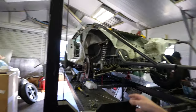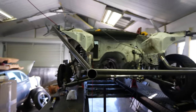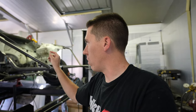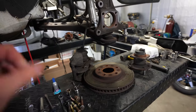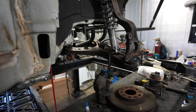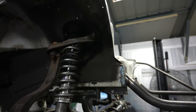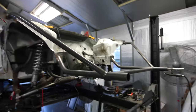We've got to put the wheel tubs on the front eventually and freshen up the front end stuff, but it's coming along. Really pretty easy to install — just making sure your cuts are as square as possible is definitely going to help. I have a few little gaps I'm having to weld but it is what it is. Alex has been working on getting all the old brake stuff out so we can get ready for the new brakes — came out pretty decent for a car with 150,000 miles. I think I'm going to order some tubular lowers and try to run some adjustable lower control arms.